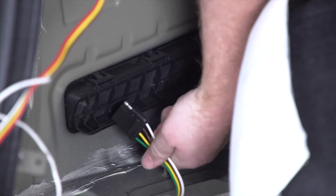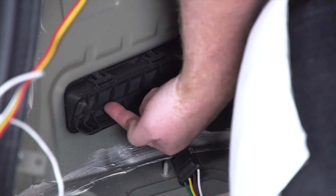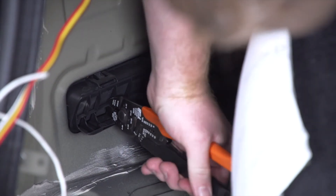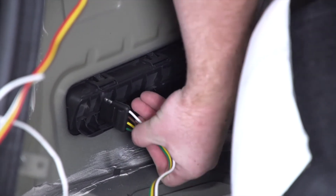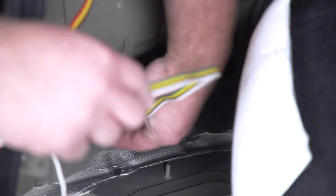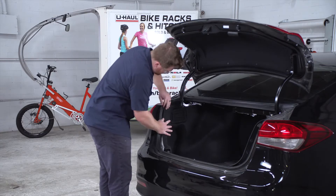The grate is too small to let the four-flat harness through, so we're just gonna cut this little tab here to make it big enough for the harness to fit. Then we'll take the four-flat harness and push it down through. Now that we're done in the cargo area, we're gonna put everything back together, making sure we keep our trailer wiring behind the panels.